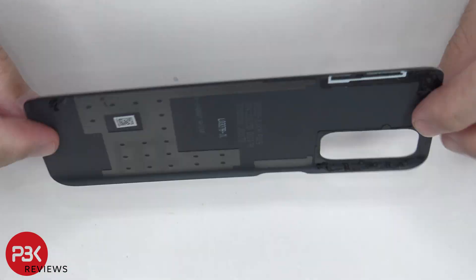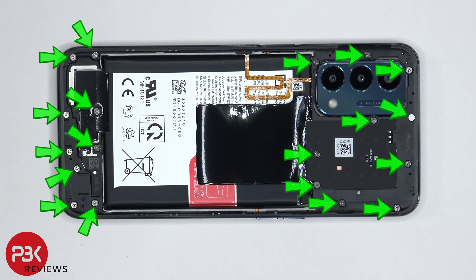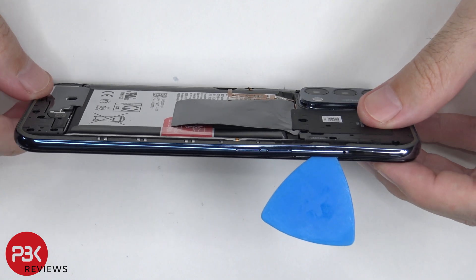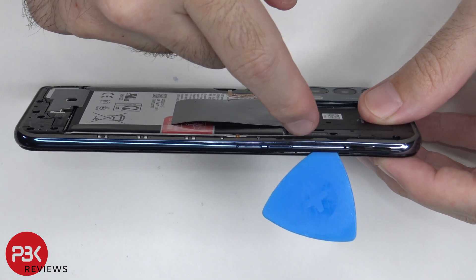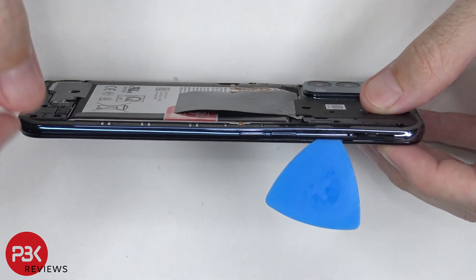Here's a look at the plastic backplate. There are 19 Phillips screws which need to be removed. Once all the screws have been removed, we're going to take our plastic pry tool and place it in between the back housing and the frame of the screen, and then we're going to run it along the edges of the back housing and pop the catches off.